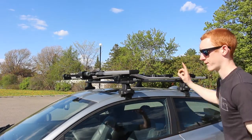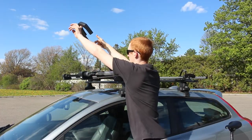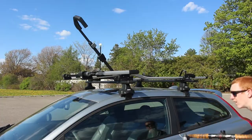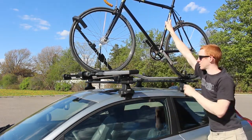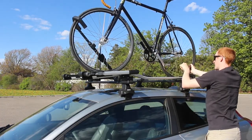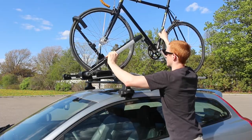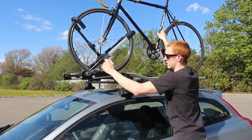Now let's get into putting a bike on it. First things first, this bar is going to swing up. You want to check the little window in here — pull this tab out, slide this up, and you'll see values pop into place. For what we're putting on today, my single speed, the 28/27.5/26 is perfectly fine. Now that we've got that set, we can put the bike on. We're focusing on getting the front wheel just in place — the back wheel can sit on the roof rack or right beside the tray. Once the front wheel is in place, lift the back, come to the other side, put the strap through the wheel, and lift it up. Push this in, pull back, push up, and listen for the big pop. Now the ratchet holds it right in place.